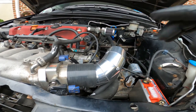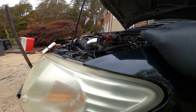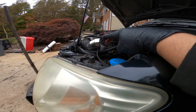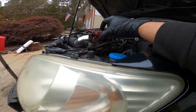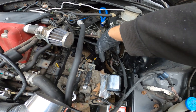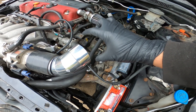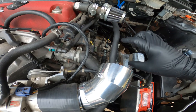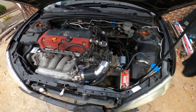This is what we got right now — gives you a general idea. We're making these pie cuts to loop down around here. I just got to hope the hood is going to close, but I think it should be fine because it's below that reference line and it's cut out over there. I need to cut probably two more pie cuts, then maybe do a straight piece and a 90 facing down — air can get in through the wheel well and back there. I'm going to cut those and get everything tacked up.